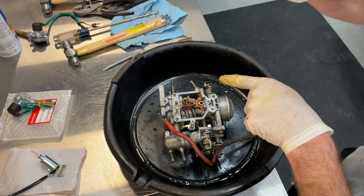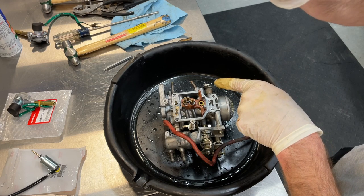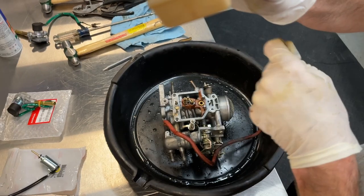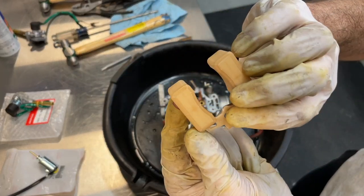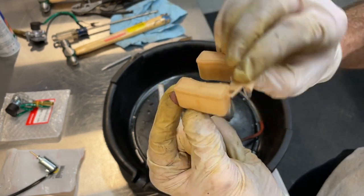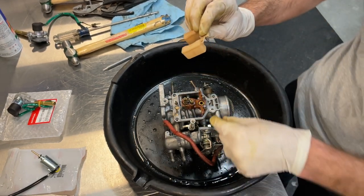And when this float reaches a certain level, it'll shut the fuel supply off, and it will allow the fuel supply to fill up the bowl as needed, all based on buoyancy. For all of our mechanical or fluid engineers, we know about the force of buoyancy.